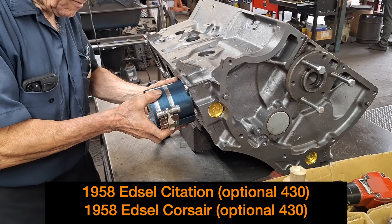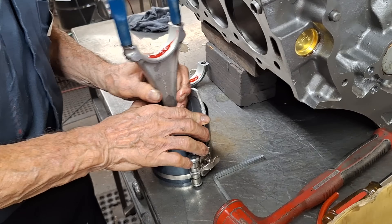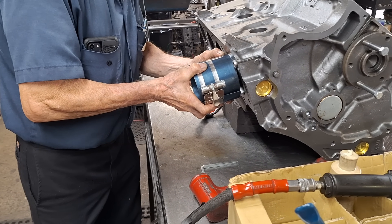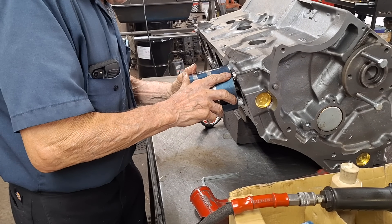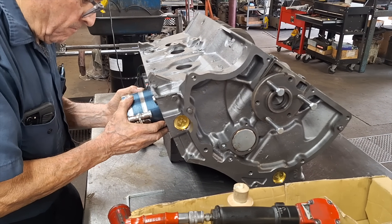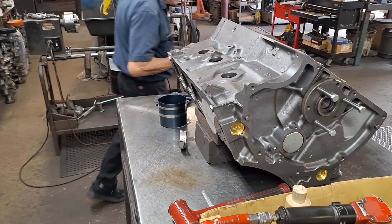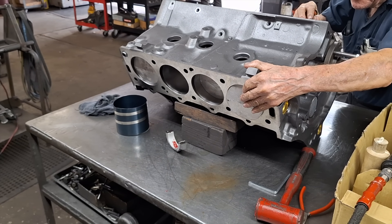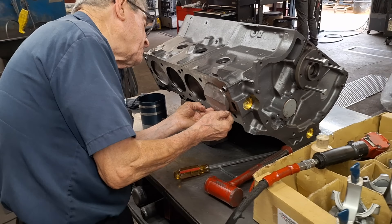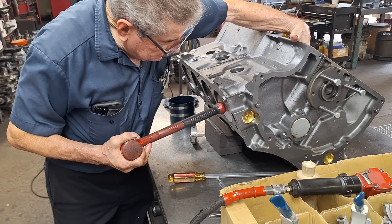See if we can get this one in on the first try. The way he's putting in this sheet metal style compressor, he's positioning it in a specific spot that helps with installation. He rotates it around to make sure it's right where he wants it. Not quite this time — we'll get it out and give it another shot. He's pushing on the bottom of the piston. There it is — sometimes you got to use your fingers to push the rings in.